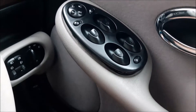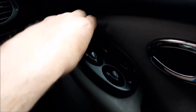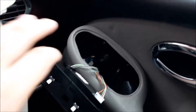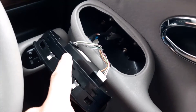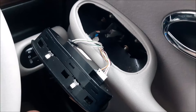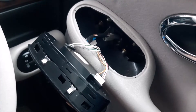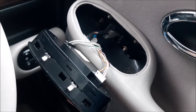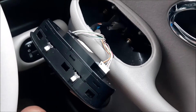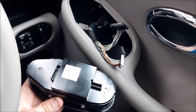It's a case of levering it gently all the way around — I've levered it all the way around now — and then you should be able to reach in and just pull it out like that and leave it to the side. You can see you've got two plugs, one at each end to remove. I'm imagining one set is for the electric mirrors and the other is for the electric windows, which seem to be working fine, but a good clean out will certainly be worth doing.